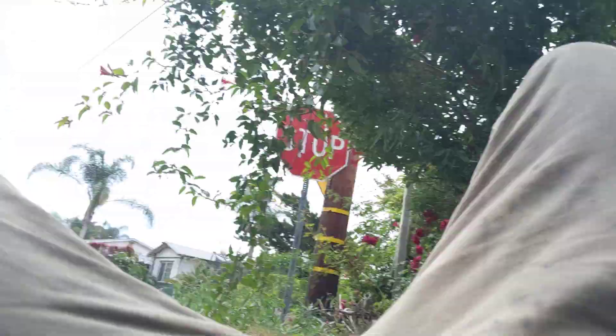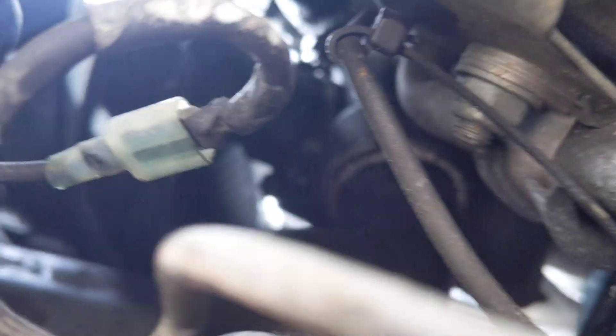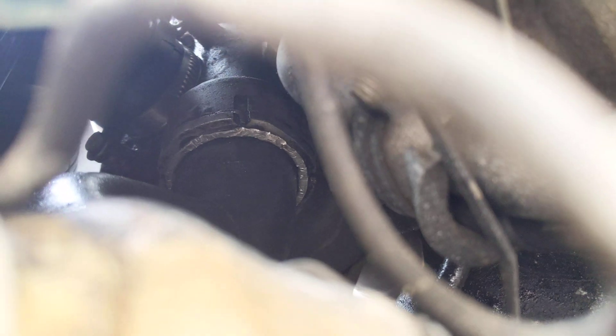I'll show you where that is - you can see my finger pointing at it, that beat-up silvery flange. I'll give you a link to an o-ring that fits this. I couldn't find the factory part, but find something suitable for high temperature and motor oil exposure - it's a fluorocarbon or Viton type, but it's special, not just a regular Viton o-ring. Also make sure the clip on here is facing the right way, or it's going to pop off when you drive and your car will go into limp mode immediately.